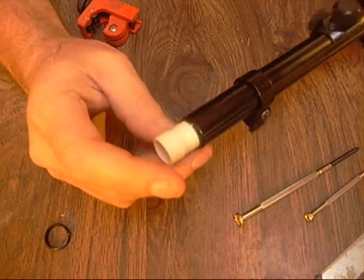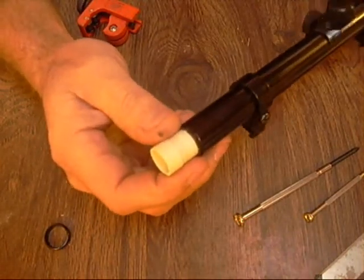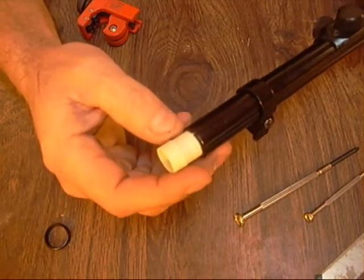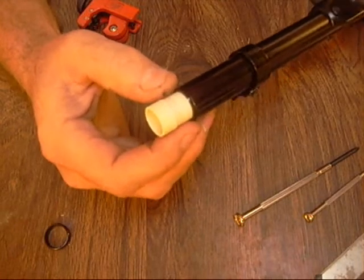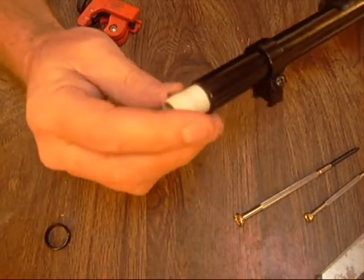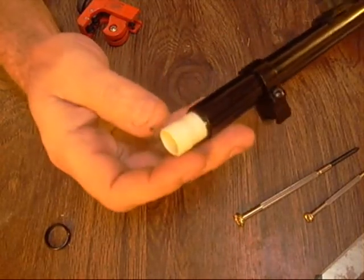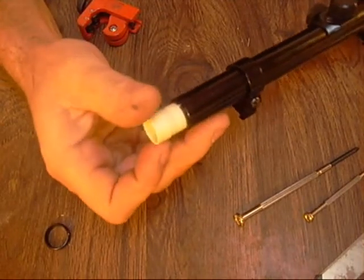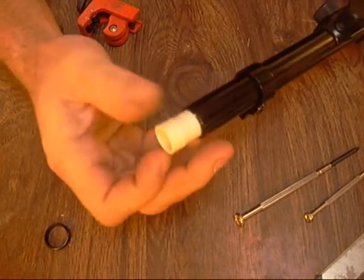That's really convenient about the 15 millimeter objective lens - one revolution equals 10 yards, so you can set this up to adjust out to 30 yards, 20 yards, or whatever you're shooting. The main thing is the error really isn't going to make much difference if I set this up to 20 yards and shoot 30 or 10. What does matter is my ability to range it - is it 30 yards away, 25 yards, 10 yards? It's more of a practice thing for range estimation. So if I zero at 25 yards and shoot 35 yards, I'd screw it in one full turn.